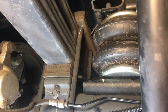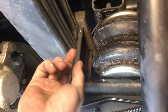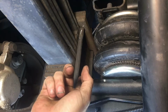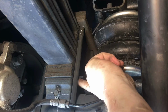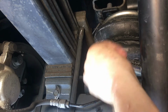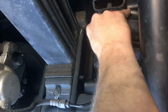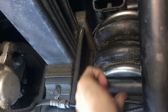Okay, after you make your marks, go ahead and dry fit one more time. Keep in mind, when I was talking about diesel or gas here, these flares on the bottom bracket go inside of the U-bolts on the leaf spring. So when you get this thing in there, make sure you get the little flares on the lower bracket inside the U-bolt on the leaf spring, and also confirm that your dowel pin is in the right hole and it will not flex, which we have done. We're in the dowel pin, we're inside the leaf spring, and the U-bolts are going to wrap right on here.